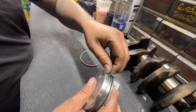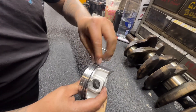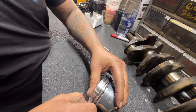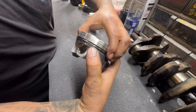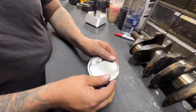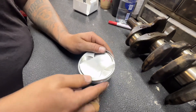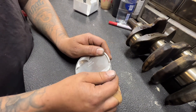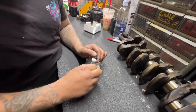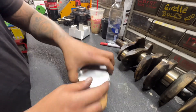This is where the ring installation tool really comes in handy. Pull it and get it into its groove, slide it down. Now for the top ring — also facing up — same process. Set it there and carefully work it around. I'm always scared that one's going to break. Catch one little groove in the piston and you will break that ring and be stuck waiting to order new ones.